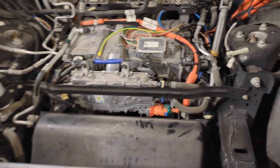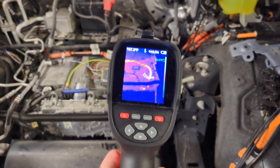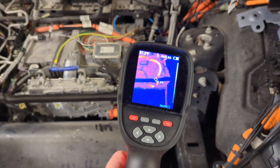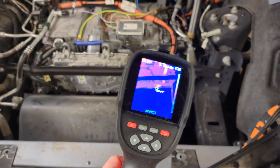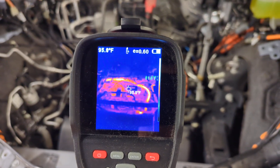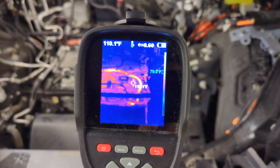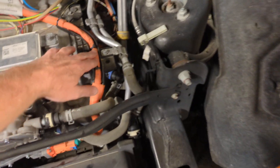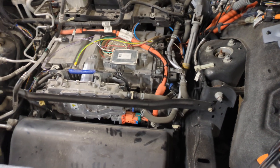They wasted quite a bit of wire doing that, but you'll see with the thermal camera booted up — that wire is hot, literally and thermally. It's basically high voltage DC coming out of the back of the charger all the way around to the DC-DC converter and then back to the battery. The truck's been charging at 11 kilowatts and all components are cool relative to that wire, which is probably around 110 degrees Fahrenheit.